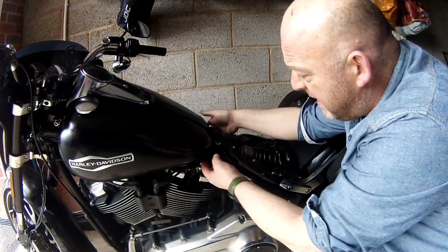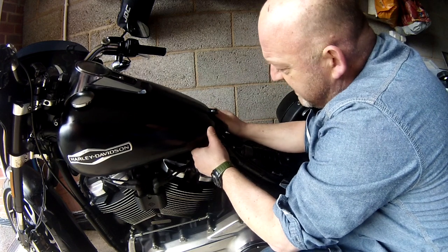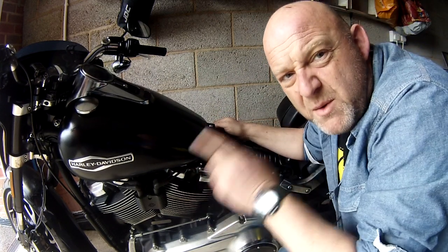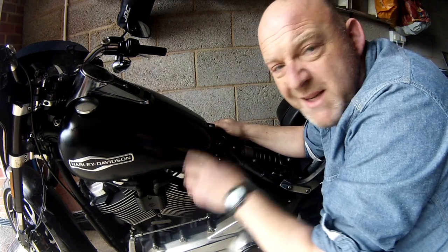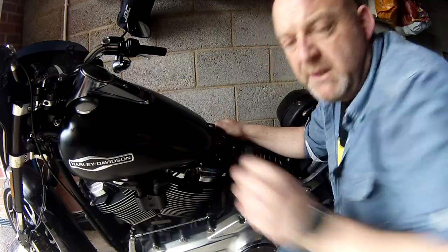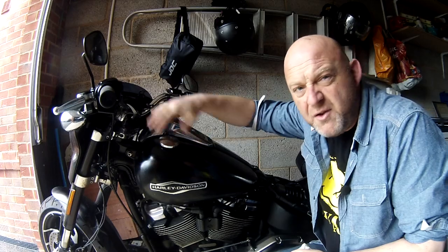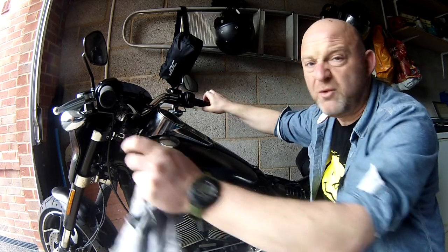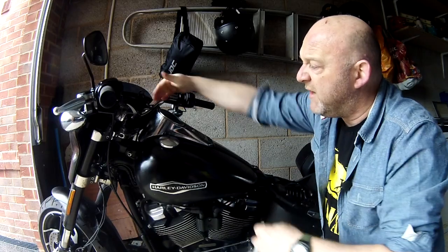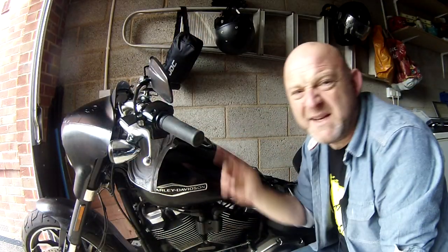The next thing to do is literally just lift the back of the tank up like so, just so it clears a little bit, and then just rest it back down. All you want to do is make sure that nothing is binding in that first inch or so. At the front of the tank as we're lifting up the rear, make sure that nothing is going to catch on the handlebars. Make sure your handlebars are straight and also that it's covered with a rag or something just in case.